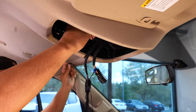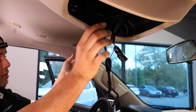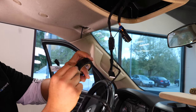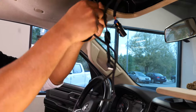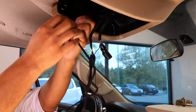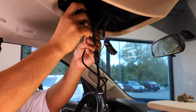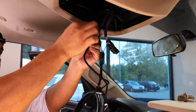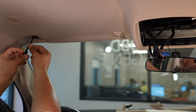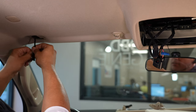Stick your finger on the other side and you should be able to feel it and pull it through. I'm just going to tape the end that I want to run over there to this side of the zip tie. As you're taping it, don't pull the other end of the wire back through or you're going to have to fish it through again. Once you get your zip tie pulled through to the other side, you have your wires — get all your tape off.